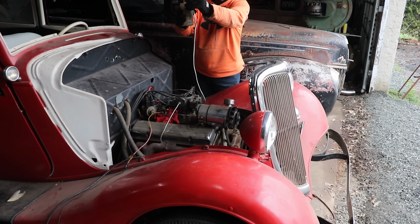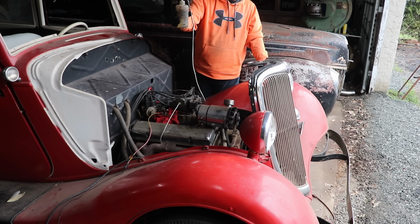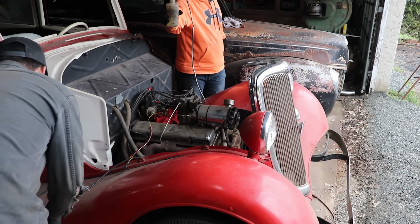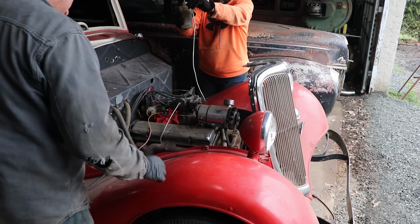All right, so the fuel pump is definitely bad as we expected, and we just got it cobbled together, set up here with the squirt bottle just to try and feed it some more. This is our last try to see if we can get this thing to idle before we actually start putting new parts on it, but figure we'll give it a try. One last hurrah. Got spark at the ignition.